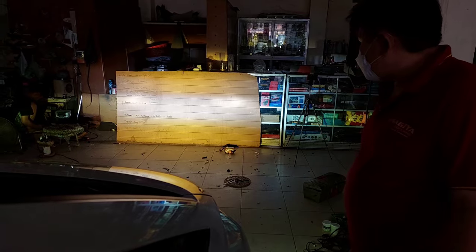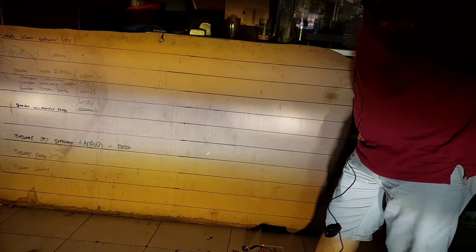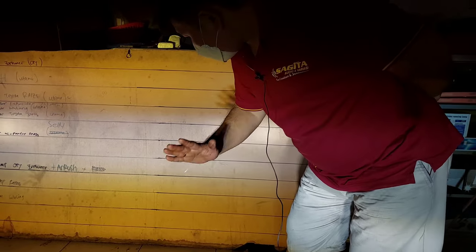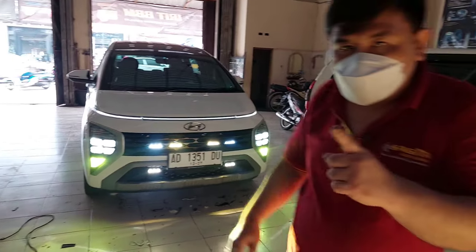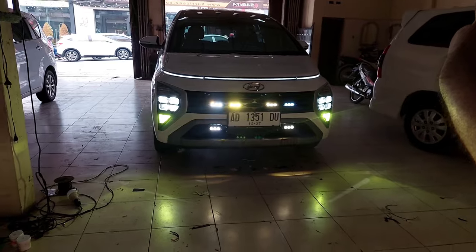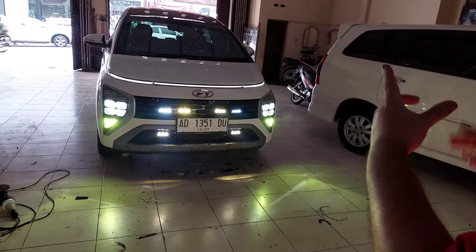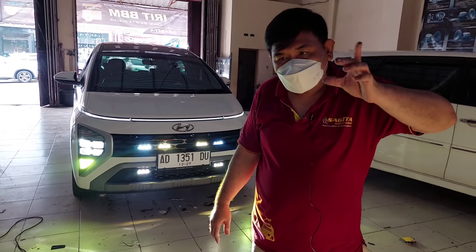Again, high beam. Come closer here, Masri. This is the low beam section — the bottom is still yellow. Then this is the fog lamp section, still yellow. The low beam section still has yellow and white. Then the high beam section, the color is yellow, everyone. This really helps fill everything in with no gap from top to bottom. Everything is full. And this is suitable for use outside the city. In front, there is no glare at all — because the lamp installation is angled two degrees downward, so it does not cause glare. Usually with mini projectors many people complain about glare, but not this one. On the board that's about 5–10 cm down.